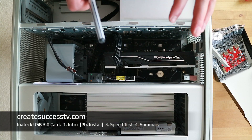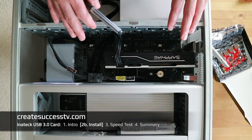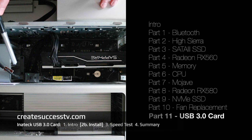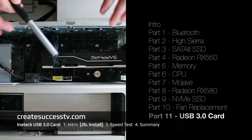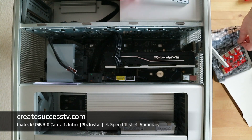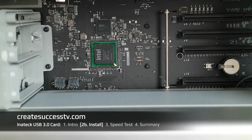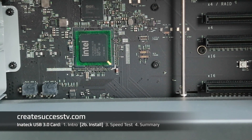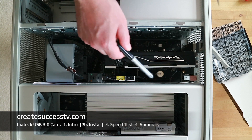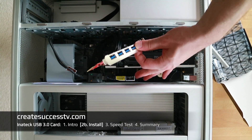In Part 2b — if you've watched my other Mac Pro upgrade videos you may be familiar with this setup. This Mac Pro is heavily modded: I put in a Sapphire RX 580 graphics card, an NVMe drive, and even modded the fans with Noctua fans in the CPU and power supply. What I'm missing is the USB 3.0 card. The PCIe slot layout: the bottom slot is 16 lanes, the second slot is 16 lanes, and the top two slots are four lanes each, so you can pick and choose where to put the graphics card.